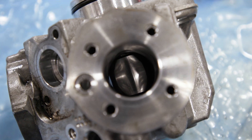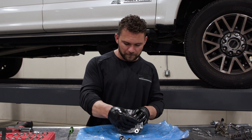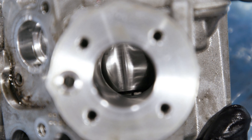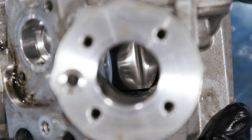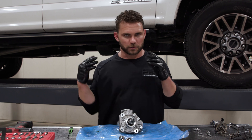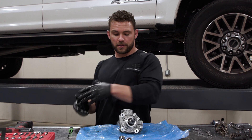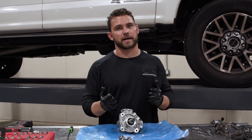Let's take a look at this camshaft. Looking down at it right off the bat you can see a little bit of metal on top. We'll spin it over and look at all the flat and high spots — you can visibly see some material on top of this camshaft, but it's not that bad. With this customer's truck, it was towed in, wouldn't run — he said it lost all fuel pressure and would not restart. We drained the fuel filters, cut them apart, and found metal inside those filters. If there's metal there, there's metal inside the pump — and that's exactly what we just proved.